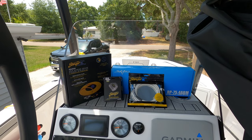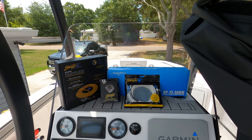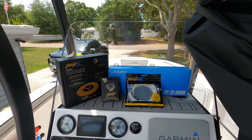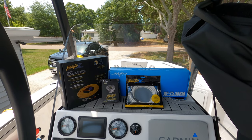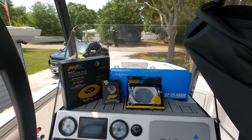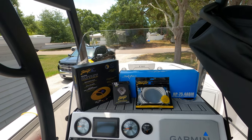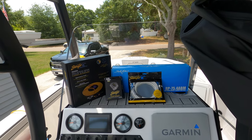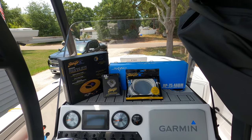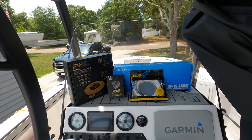In the future when I decide to do my tower speakers, I will have all four channels ready to go. I will only be utilizing two of the channels at this time so that I can get a little more power from my swim deck speakers when I want it. As of right now they're running off of zone two off the head unit's internal amplifier, which is the Kicker KMC5 — it is a premium unit with higher RMS wattage than most.